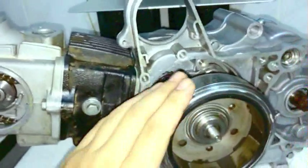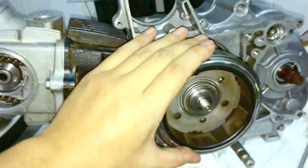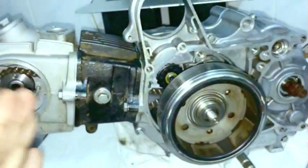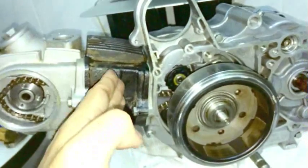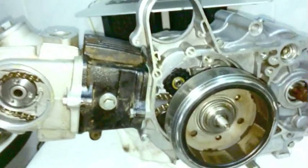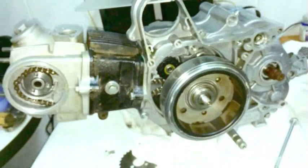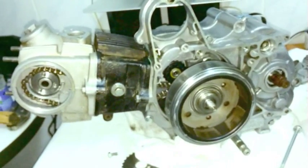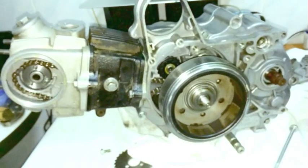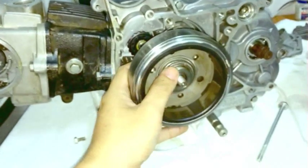This is why I like to find top dead center mechanically. If I can see the piston is at the top, I know I'm at the top. It's not like the piston is magically here and there, like some sort of quantum phenomena, okay? I'm sorry, just keep going on. But these are the things that have wasted so much time for me as I was trying to build the engine, and I want to share them with you so you don't run into the same problems that I did, okay?